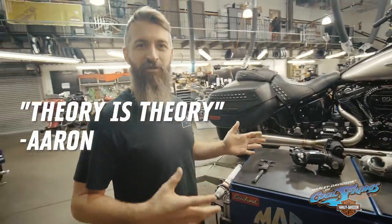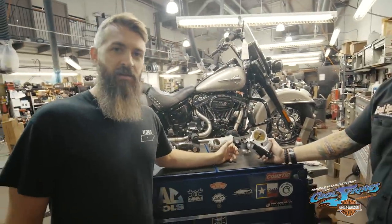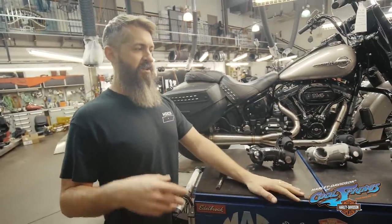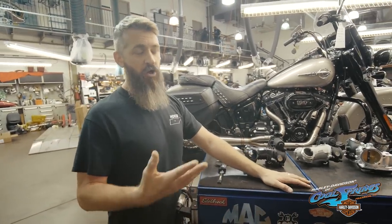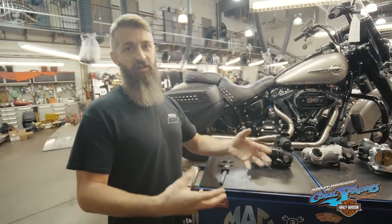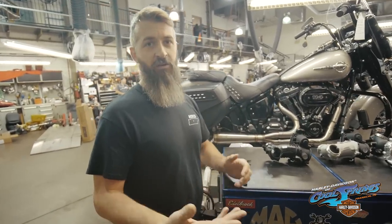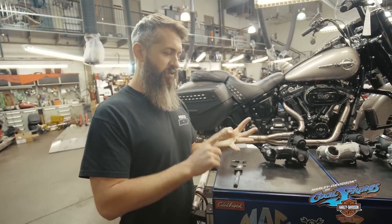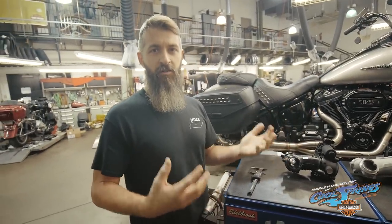With intakes, bigger is not always better. Sometimes we don't want to run a huge throttle body because you lose that bottom end and the flow doesn't match the head. An intake needs to be matched to a head, to a cam. Small cam, small head, small throttle body. Larger cam, larger head, larger throttle body. Large displacement, larger head, larger throttle body. You have to have everything work together. Compression, motor size, cam, and throttle body — those four things are the most crucial things to match up together. That's what makes the motor the motor.